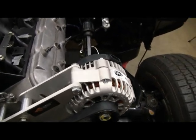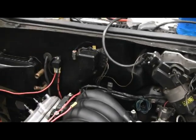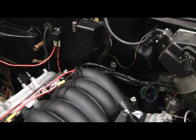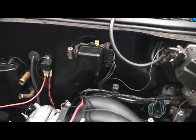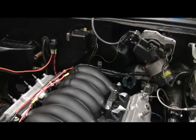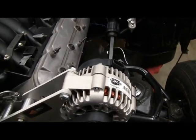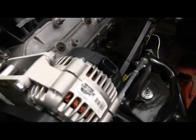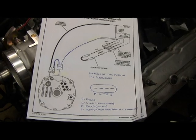In '68 they used an externally regulated alternator — that's the external regulator there. The new regulators have been internally regulated since the mid-70s or so. Obviously my wiring is set up for the external. That mess there was to convert it to one of the mid-70s style regulated alternators. You can't just get rid of all that because the dash charging light won't work, which I'd like to have working. So there's got to be a way to convert from the old style — called a 10DN type external regulated alternator — to this style, which is a CS-130D type alternator. After much searching and many phone calls, I came up with this modified sketch showing how to wire this thing up.